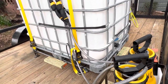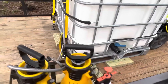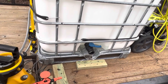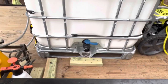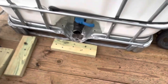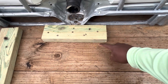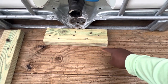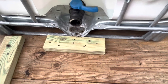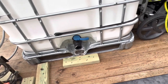I went to Home Depot and got eight feet of pressure treated wood. I asked them to cut it into one-foot pieces and I put them right around where I wanted the tank, then screwed them down. You're going to need a drill and multi-purpose or wood screws that are three to four inches. If you only use two-inch screws, they'll pass through the two-by-four but won't penetrate the trailer floor enough to be secure. You need three to four inch screws to properly anchor into the trailer floor.